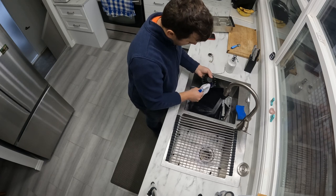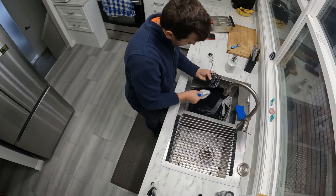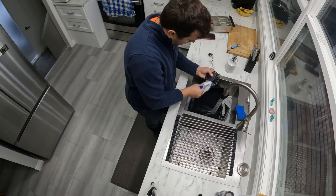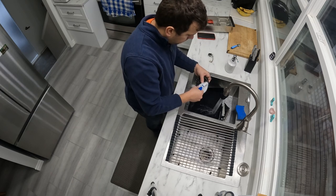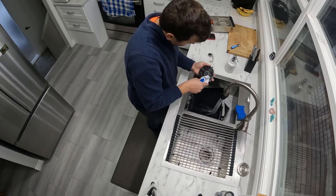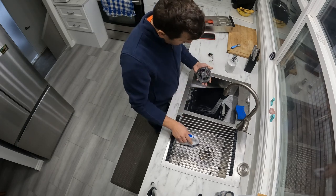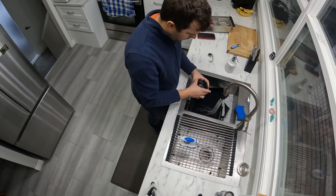Right now I'm washing out the fan with hot soapy water. This was the way I wash my fans out on my consoles that I sell and keep. So I don't put water inside the center hub where the armature lives and the control board. I just wash the fins with the hot soapy water, and then afterwards I will flush out the water with isopropyl alcohol, 99.9%. And I haven't had an issue with that yet. It's the only way you can get clean pretty fast and without taking your time. It is a cheat and I use it to my advantage.